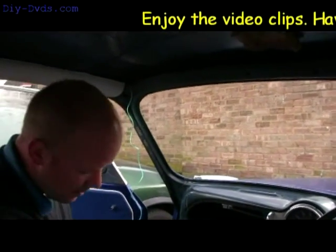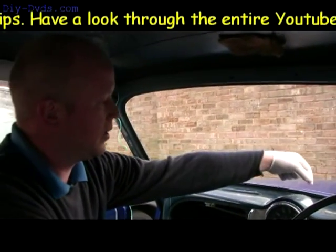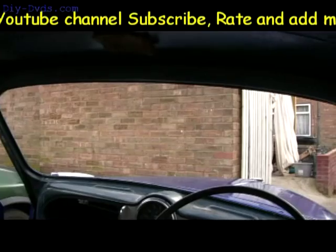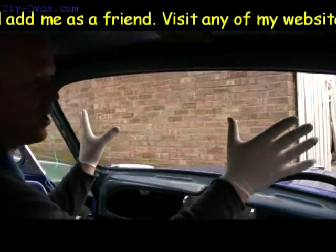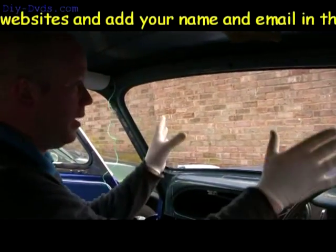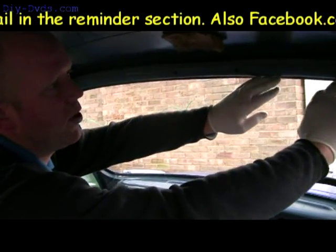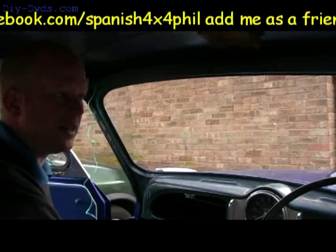I've popped the windscreen out. I've not filmed that because that was done on the bodywork. Basically, you just take the trim out, the chrome strip out of the window around the front, and then you need someone inside with a boot on the windscreen either side, gentle pressure, probably more than gentle pressure, even pressure at the top, and then you just pick the rubber down while you keep the pressure on, and eventually it just goes. Took about 5 minutes.